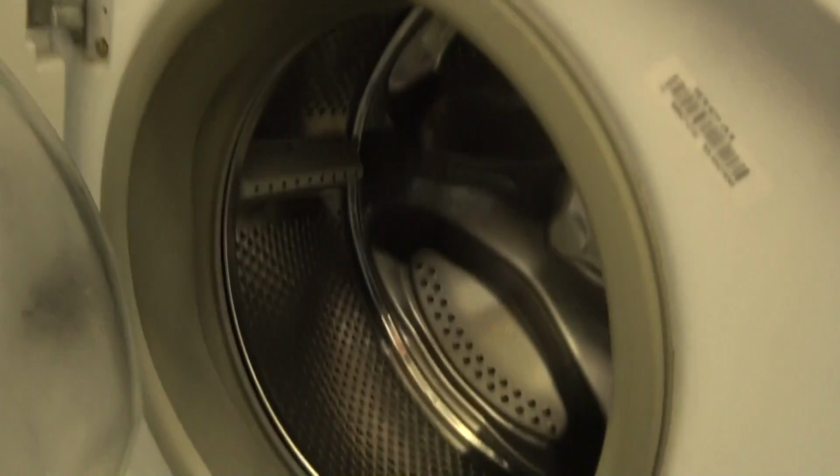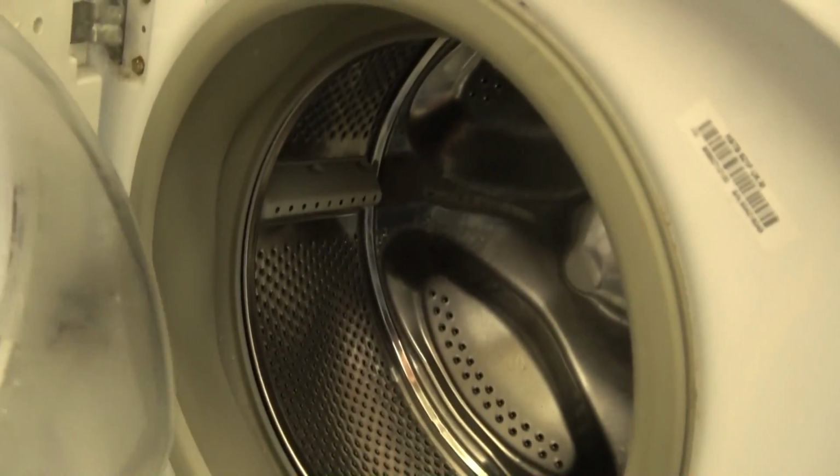I suspect it's tripping because either the heater might have a slight earth leak and therefore need changing, or the motor might have a slight earth leak and need changing. If I can get it to wash, generally speaking, it sounds more like the motor. But then again, I'm going to have to sort the plug out first.